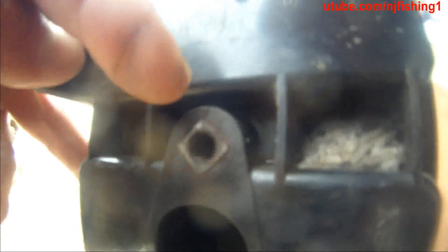The part number is 14950-1S718 Nissan, and this one you can see — as my finger is pointing — there's a crack. It's a 14950-1S718, so this is the broken emission evap canister. You can see that crack is on this side at the 3 o'clock, also the 6 o'clock and also the 9 o'clock. The 9 o'clock crack actually goes into the canister.